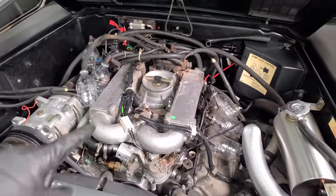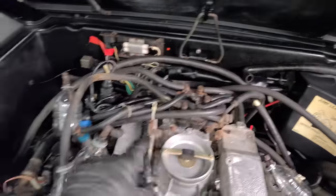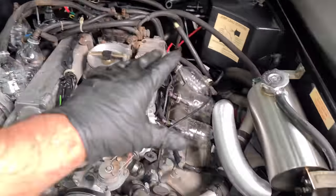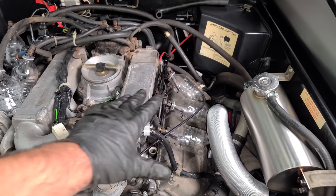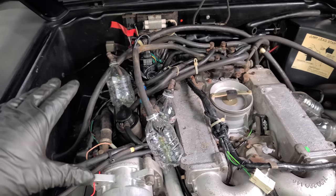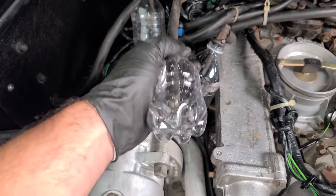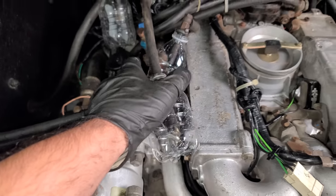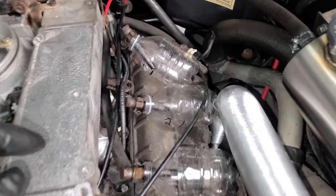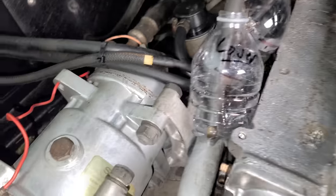DeLorean. Now, before we try and clean that fuel injector, I wanna diagnose if this is an issue with the fuel distributor or this line. So I've emptied out all the fuel. We just discarded it because, you know, that one was cloudy. It's probably all bad because that was our first flush of the entire system. But anyway, we have the injector out, all of our little bottles back in, and this is no injector, just the line. We have just jumped it again. Let's see, without me pushing down at all. Okay, we're good, now let's see.